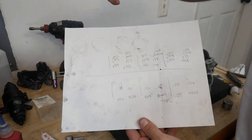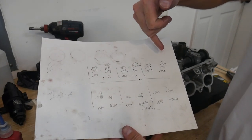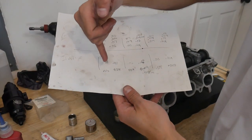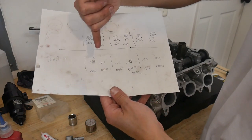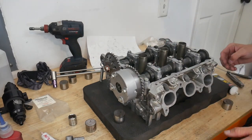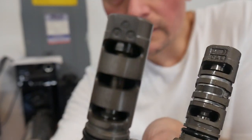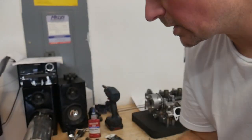Final clearances — starting with the back exhaust we have 12, 12, 13, 10, 11, and 10. We're supposed to have 12 there, so we're very close. On the intake back we have 10 and 8 — those are supposed to be 9, so that averages out to 9. Then a 9, a 10-11, an 11 and a 10 — that's really very close and that's going to be just fine. Now, these are two different oil control solenoids. You can see the cutouts are a lot different on each side, so I'm going to use the original.